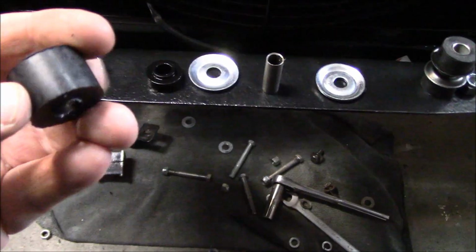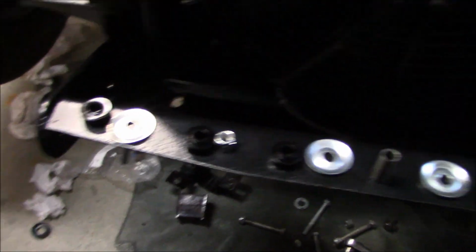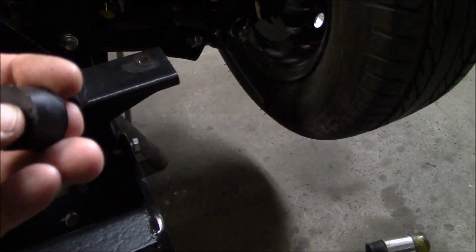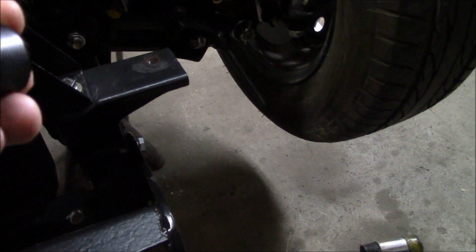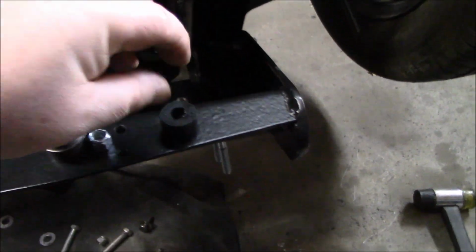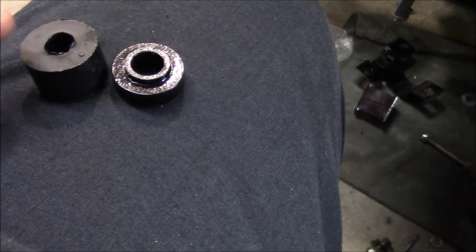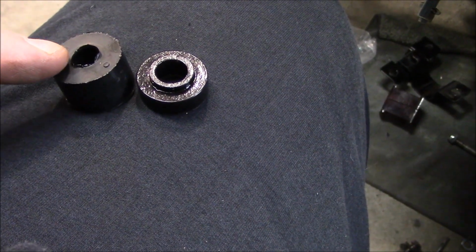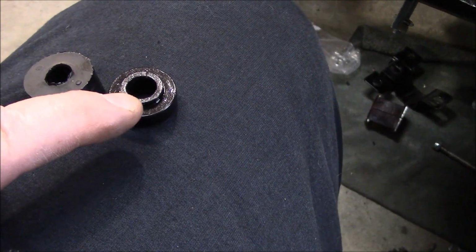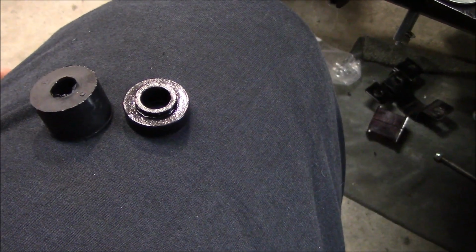The other thing is, the bushings that actually come on the end links do not fit with the sway bar. You can't actually get the bottom of the link through with the thickness of these bushes to be able to even start a nut. So I'd have to compress it some way, shape or form. Fortunately, I ordered the poly bushings, which are this thick. So comparison wise, look at the difference in thickness. There's no way I was going to be able to even thread that end link with these bushes being utilized. So luckily I've got the poly bushings, and we'll go with those, which will allow me to thread the nut on the end of the end link. Anyway, just a little bit frustrated. This sway bar is kicking my butt.